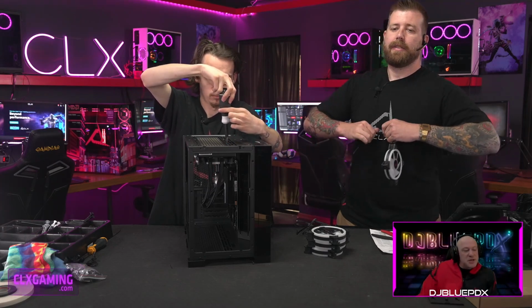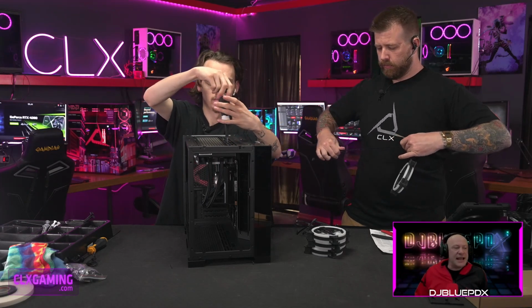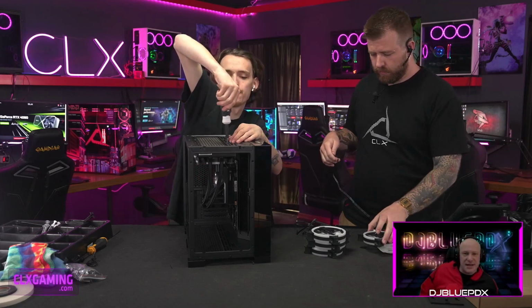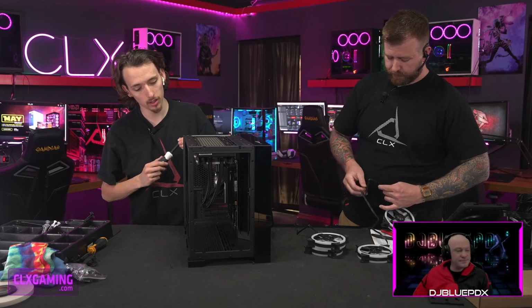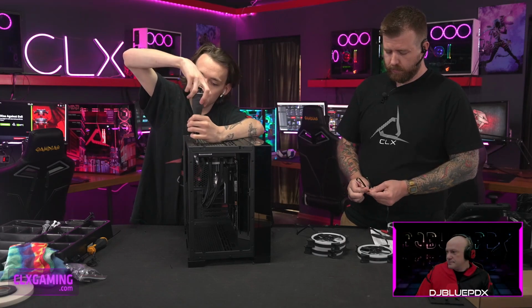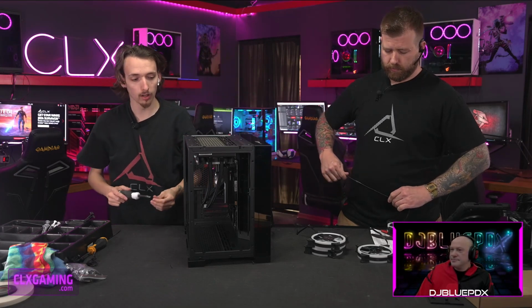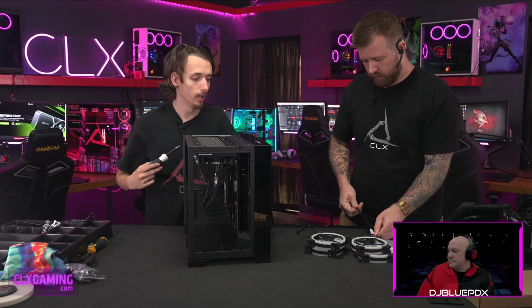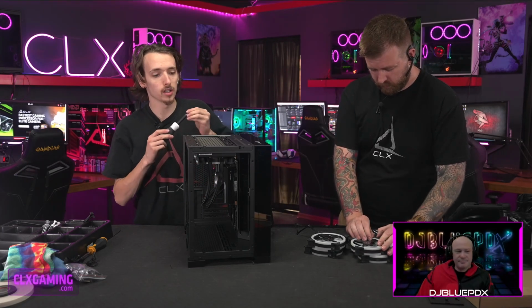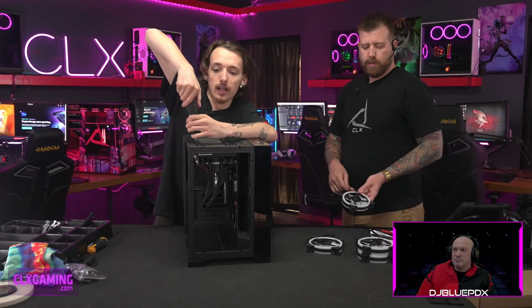Okay, now as far as cable management goes with the fans, what are some great tips on how to manage that and how to ensure that you're not risking things running into any of the fan blades? Well, as long as you are pulling all of your slack through, and then like what I'll show you here in a little bit. Once we get all our fans in, I will run all my fan wires out first, get all of those plugged up into the fan controller box, and then that's out of your way. So you can get that taken care of, and then you have your bigger cables left to deal with.